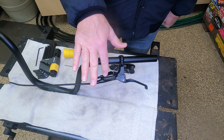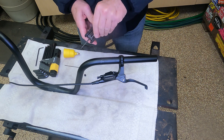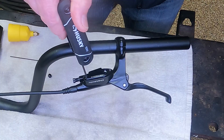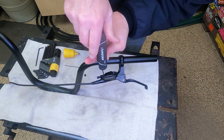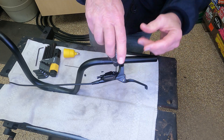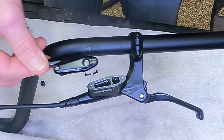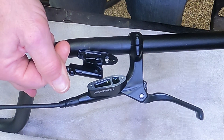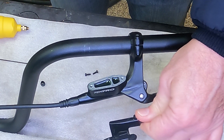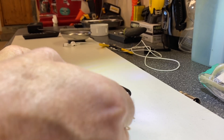For most of us, that will be as far as we ever need to go into the master cylinder. But I want to show y'all what's going on — you need to learn this. To take the master cylinder cover off, we are looking at a T10 Torx wrench and two screws. Let's take those two screws off. There's no O-ring on this cover, and you'll see why in a second. Same size screws so you can't mix those up. Now this lifts off — look at that. There is your hydraulic fluid, and here is the gasket for that hydraulic fluid.